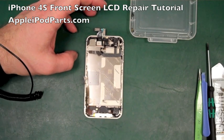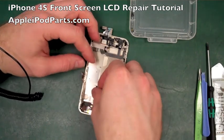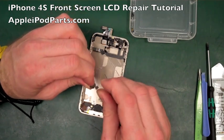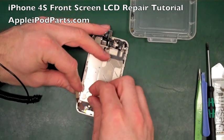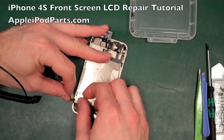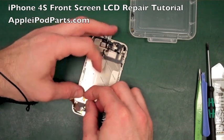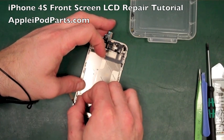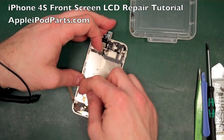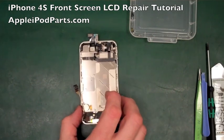First thing we need to do is put the vibration motor back on. Now, sometimes when you lift this up, you can bend that little contact. Those contacts, you might see they're bent up a little bit, just giving them a little bit of a flattening out. That's all they need, and it's quite obvious where it goes. I don't think it's absolutely millimetre critical, but it needs to go back in the right place, and you can see where the sticker was as to where it's supposed to live. Push that down gently, push the contacts gently, and you can see that little tang there sits over that. So there's the vibration motor back in.